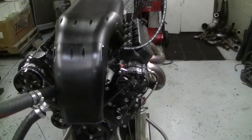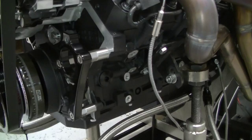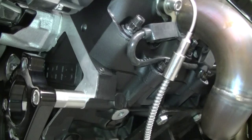So we're running through just some regular 69 chassis Speedtech headers. It's got the All-Pro six-bolt cylinder heads, so it has the additional clamping force of the extra two head bolts per cylinder. We're running a tall-deck RHS block.